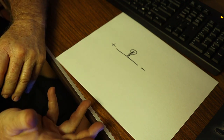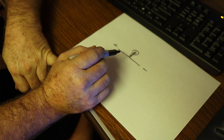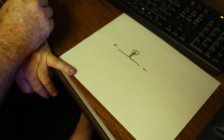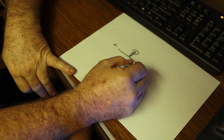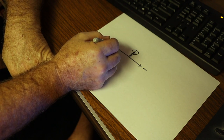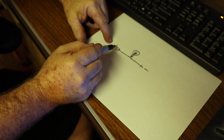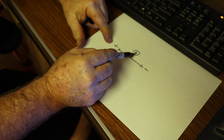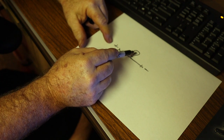That's why modern cars use an AC alternator that's converted into DC for our vehicles. Basically, all you really need to do electrical work is understand some simple symbols — I'll go over those too. We're going to start off with this light bulb. If you looked at a wiring diagram, that's your negative, and you're going to have a positive that terminates somewhere at a control circuit — either a relay, switch, computer, or something that works the light bulb. It could be in a dash cluster, tail light, or headlight. The bulb is going to pull a certain amount of current and is called an appliance — it's actually a resistor that does a job.